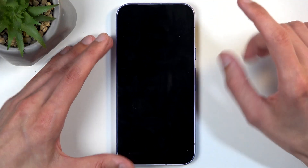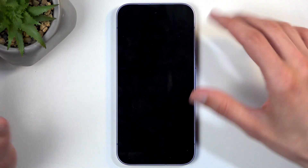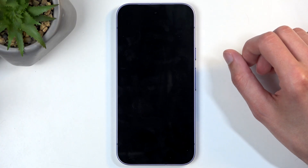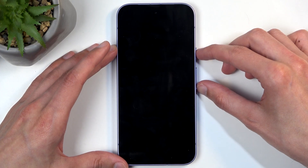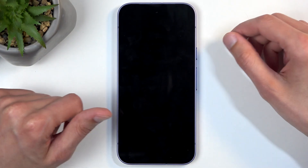Now, I want to add this just in case: if when you press these buttons — and you're doing this to get rid of a screen lock — it tells you to confirm your screen lock, you instead can just hold the power button and volume down. When you hold it for like 5 or 10 seconds, the device will turn off on its own.